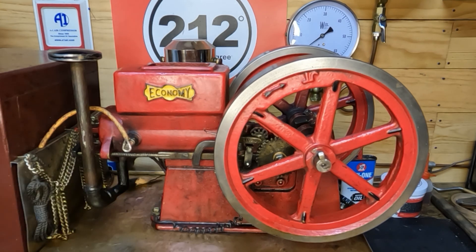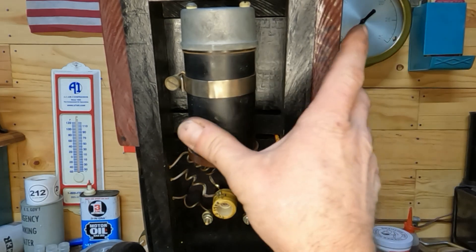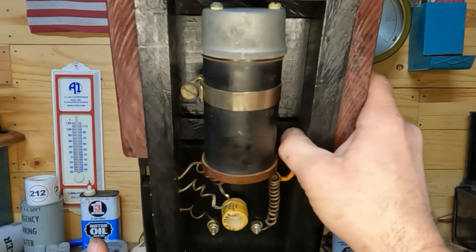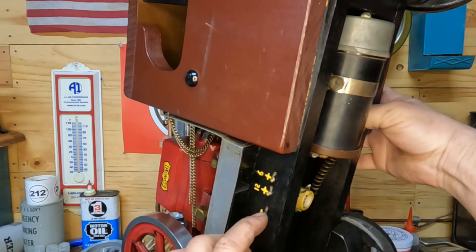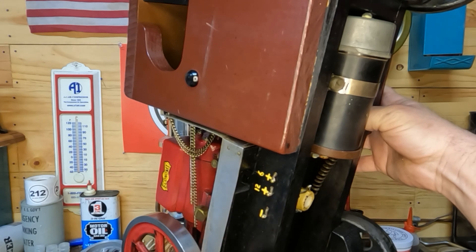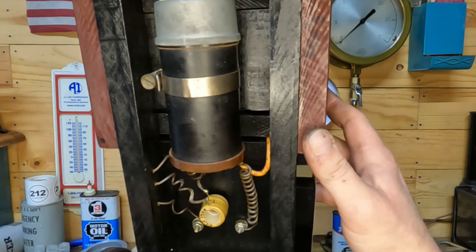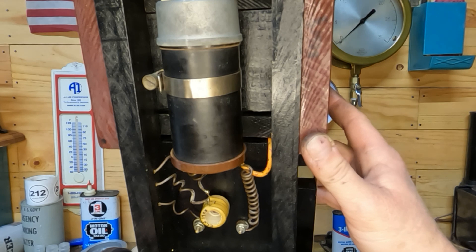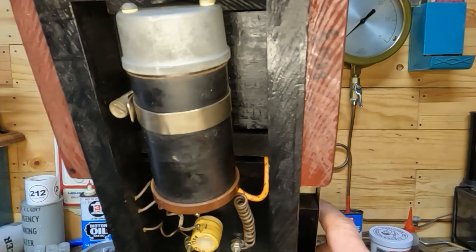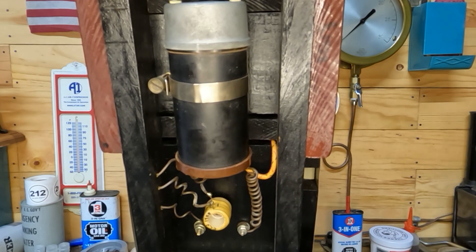Get all this cleaned up - well, this is the belly of it. It has a massive ignition coil. We've got a resistor here, and on the side we've got a terminal for ground, a terminal for 12 volt, and a terminal for 6 volt - so I guess we have options. I've never seen an ignition coil quite like that. I'm not sure what it's out of, but when the time comes we'll all get to see if it works. Pretty impressive - all right, let's get it back on its wheels and keep moving.